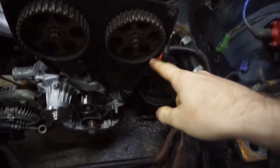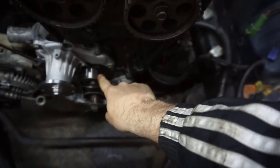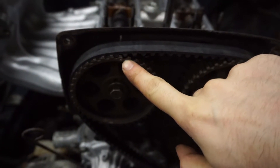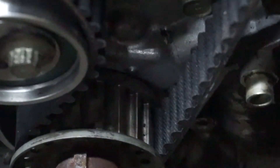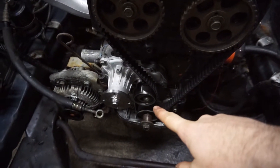So the next step is to put the belt on and see if it fits and lines up. The side without the tensioner — from this pulley down to the very bottom crank pulley — you want that to be tight, because on this side you make up for the slack with the tensioner. There's a line on the back of this that lines up with the notch and the bump on the crank right down there. Line those up and make sure this side has tension when you first install it, because this side the tension is taken out with the tensioner.